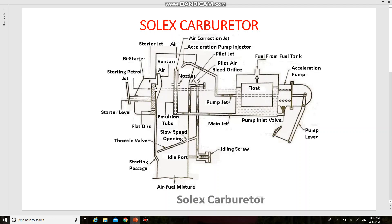The passage opens into the air horn below the throttle valve. The starter lever is operated by the driver from the dashboard, which adjusts the position of the starter valve so that either bigger or smaller holes of different diameters come opposite to the passage.